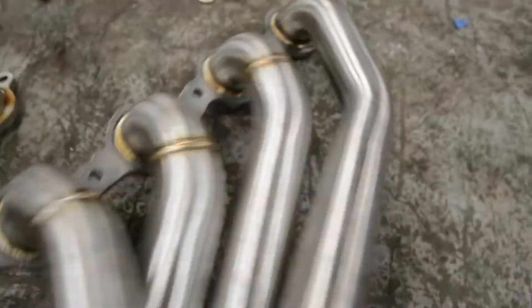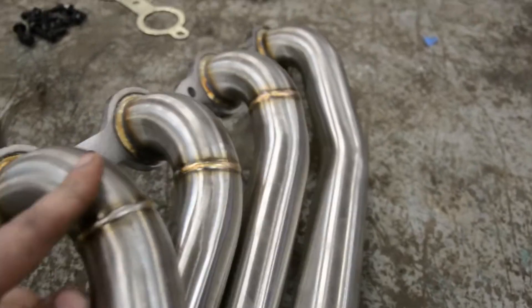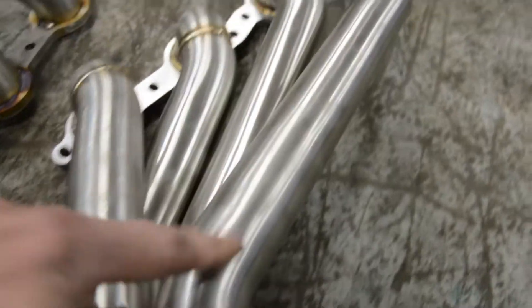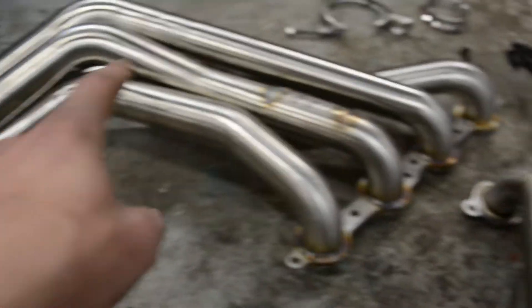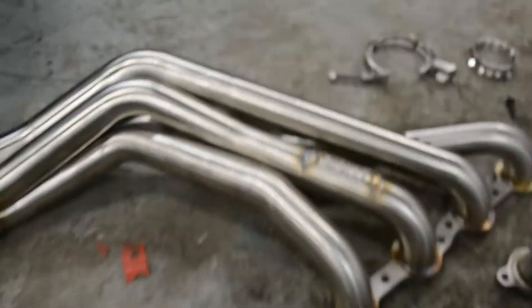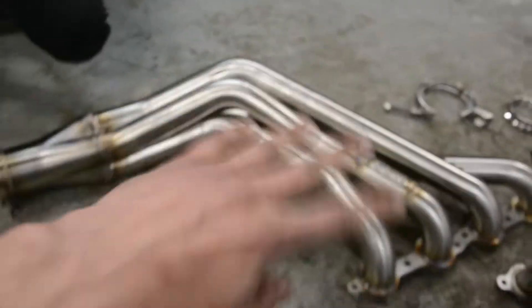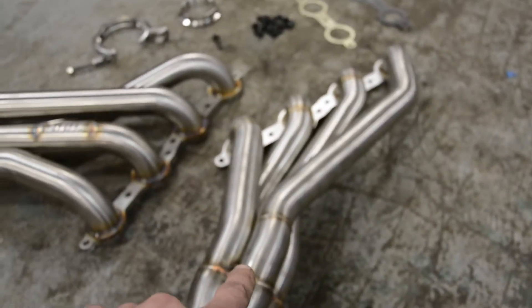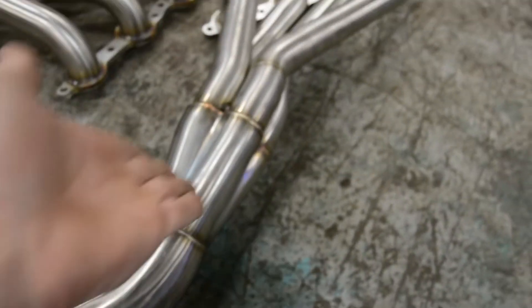We can note a couple different details about the tubing. The ISR is made of welded tubing — there are some bends and then some welds — whereas each of the SICKI tubes are bent to the entire length and then welded once at each end. That provides a stronger material and is less likely to crack at welds.